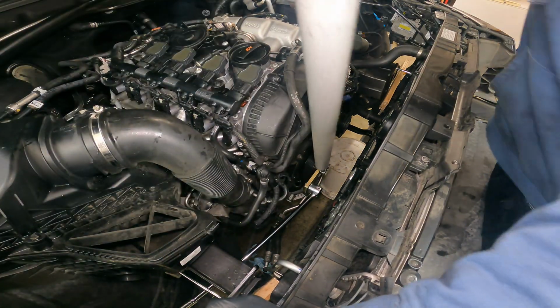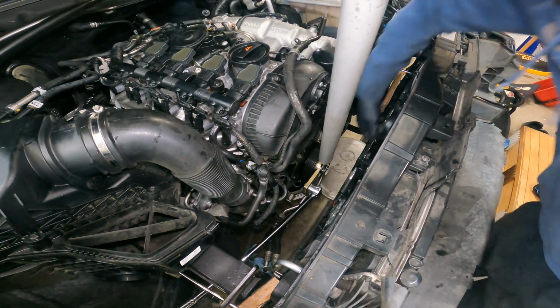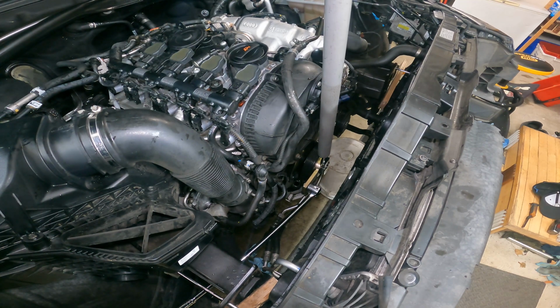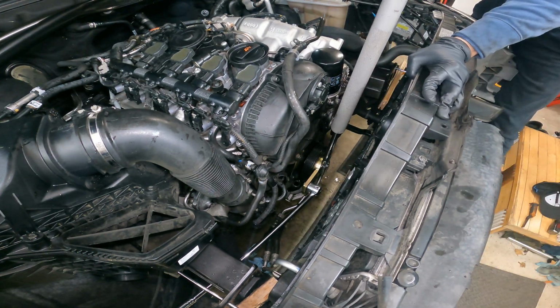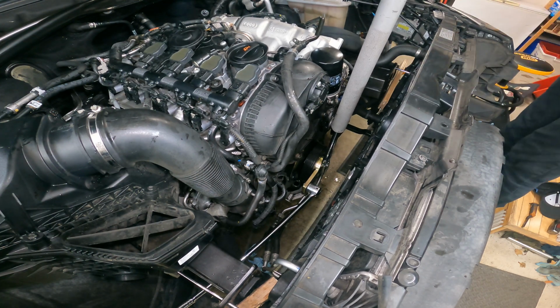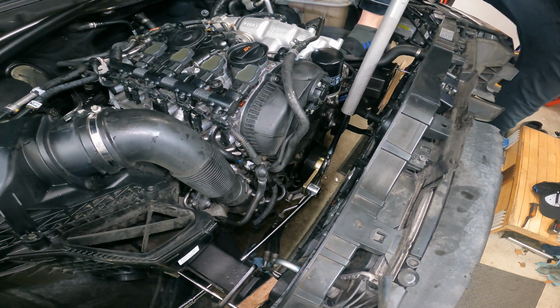When doing this, you're gonna feel like you're gonna break this bolt. You have to go as hard as you can. I had the whole jack handle on here and was yanking this thing. It's a stretch bolt. That's how it gets its final torque specifications. It's the way you have to do the final 90-degree turn. It is just how you do it. So don't stop till you get that 90 degrees. Get your foot up in there if you have to. Let's go.